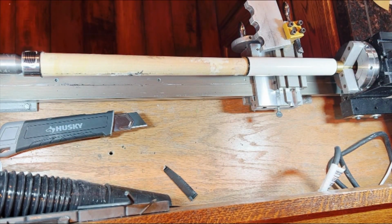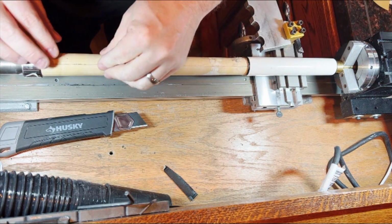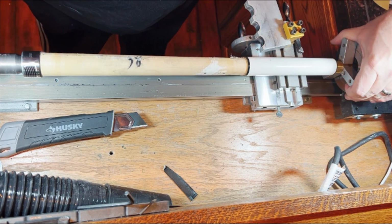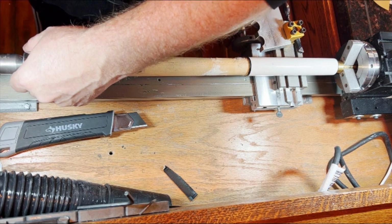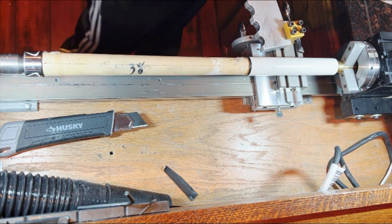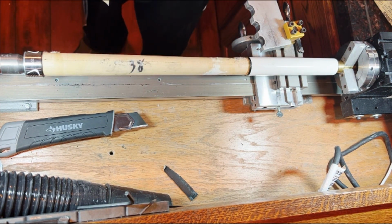I'd say that cleaned up really came out pretty good. A couple of foam tufts left here. But we'll get this cleaned up. Just gonna use some sandpaper. And that came loose. Probably just gonna use some like 150. Go over it and see if we can get some of this glue. I want to get this pretty smooth. The cleaner the surface, the better the Bondo is going to stick to it.